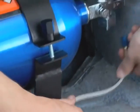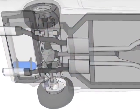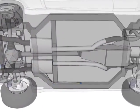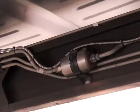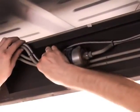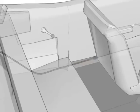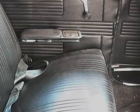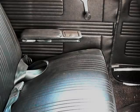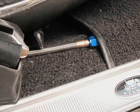As you plan a route for the high-pressure nitrous line to travel through the chassis of the vehicle, keep in mind that taking paths through the underside of the vehicle are generally shorter, but require more safety binding and strapping points. In most cases, following the fuel lines along the frame of the vehicle will work best. Paths that send the line through the vehicle interior will often use more hose length because they bend and turn along interior contours. However, internal routing usually requires less securing and/or safety strapping, as you'll be able to tuck the hose into crevices and under interior panels or carpeting.